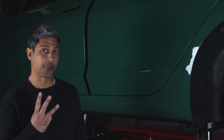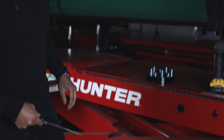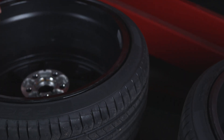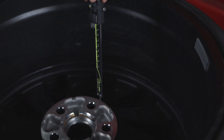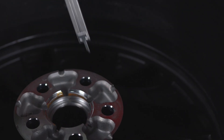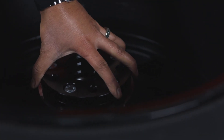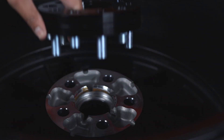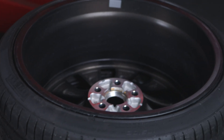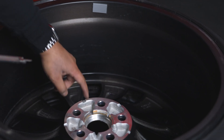This car actually had three wheels where this 15 millimeter studded spacer will work, but one of them is a different mold. We've laid them both down here to show you. This is the wheel where the 15 mil studded spacer will work — you can see there are no clearance issues, it clears, and our simulation sits flat. But on this other wheel, it's a completely different mold. You can see this pocket is much more shallow.